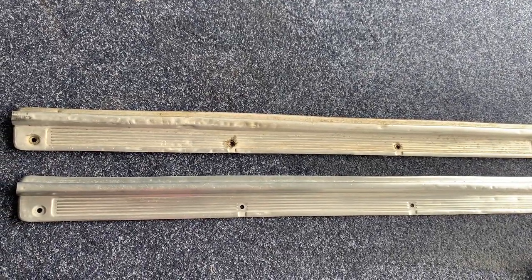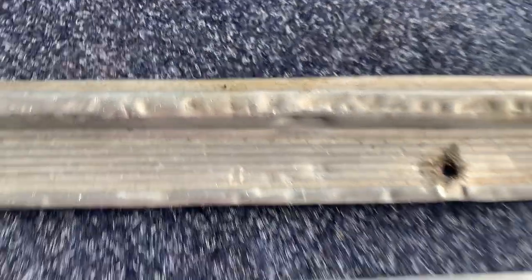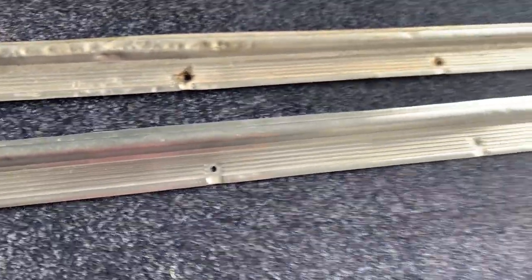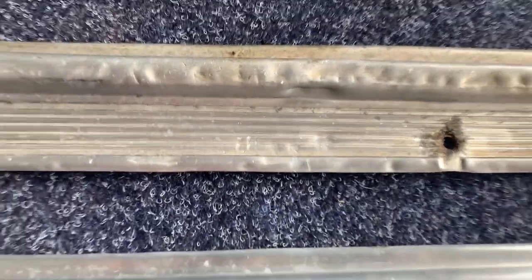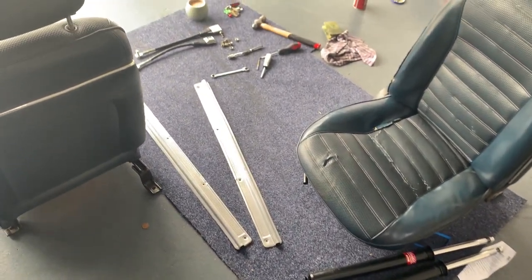Here's the result: the one on top is the uncleaned, un-bashed one, and the one at the bottom is the one I had a go at with a hammer and the back of a screwdriver. I used the front of a screwdriver for the tiny bits. I'd say they look almost like new now — they shined up really well, so I'm really pleased. I also took the front seats out, and if you've never done that before, it's actually really easy — just two bolts at the front and two at the back. Four bolts, the seat comes out with the rails, and when you want to put it back, you just bolt it back in.